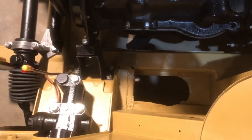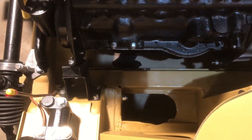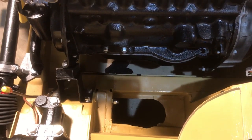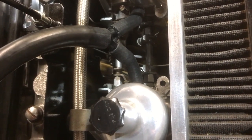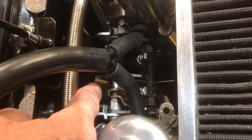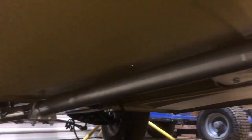So that's the branch manifold. I had to modify down here a little bit — cut it away because when the branch manifold goes down there it would have caught the web, so it just needs a little bit of clearance. I also had to modify the carburettor heat shield; I had to make an oval cut-out where the pipe sticks through. But that's now sorted and the exhaust is fitted to the car. It fits nicely underneath.